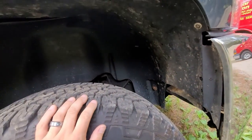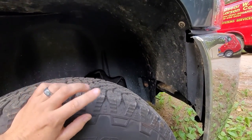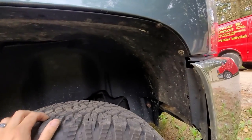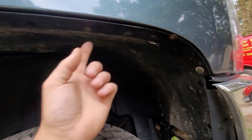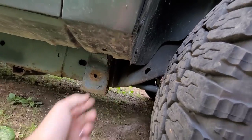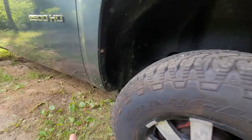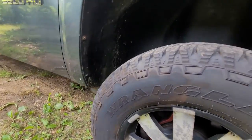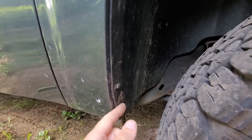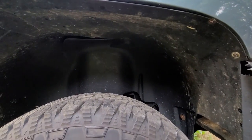First, we're going to drain the coolant. While it's draining, we can get everything else out of the way. We need to get the inner fender wall out on this side and the other side — 7mm bolts all the way around. Up top there is a 13mm bolt holding it on. If you have factory mud flaps, you'll need to remove that bolt. The rest are just standard little pop clips. Just use a flat screwdriver — push in and pull them right out.